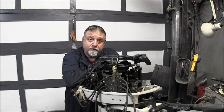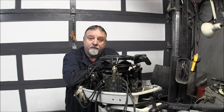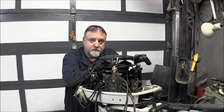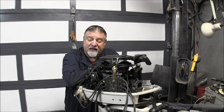And it also steps one through like four, they're going to tell you to disconnect the kill switch. I did that step right off the bat. Then they're going to tell you, steps two and three and on, if you lose spark on all cylinders or all on a single bank on a V engine, to suspect pack. So I suspect pack.